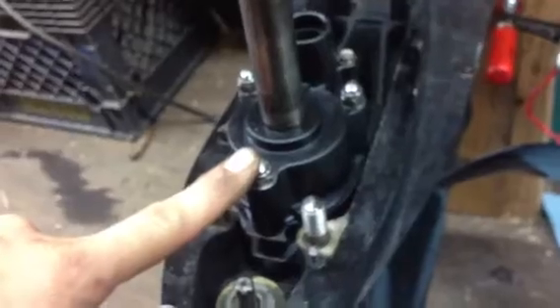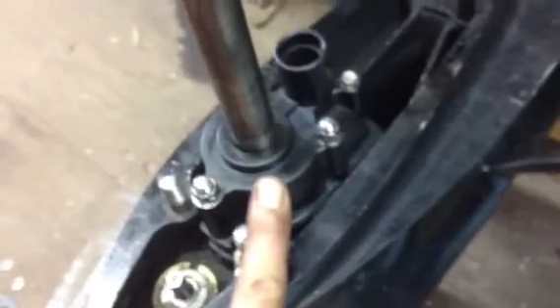So this is going to be 35 to 40 inch pounds, 25 to 30 inch pounds, 15 to 20 inch pounds — not foot pounds, inch pounds. This is plastic. It'll break. It'll fail if you over-tighten it later. And then you've torn up your motor.